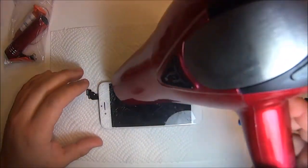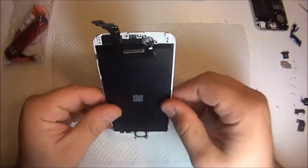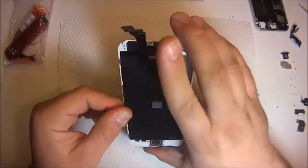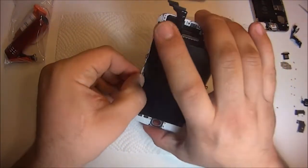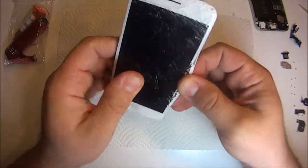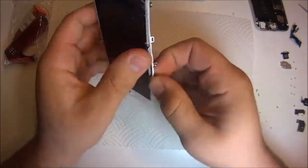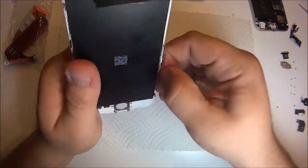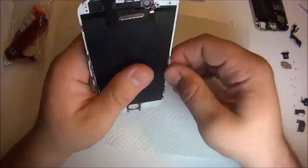And then once you remove everything and align your screws, if you guys notice, I have mine right next to that paper. Put yours as far as possible. The blow dryer is going to blow all the screws off the table. Work on a flat surface. Try not to do it on your carpet and lose all the screws. And just go ahead and heat up the phone as hot as you can till you can still handle it, touching it with your hands.